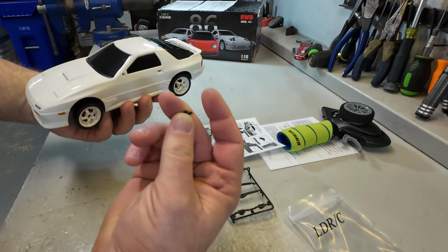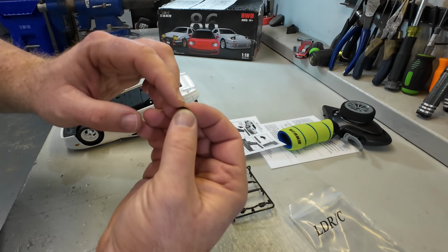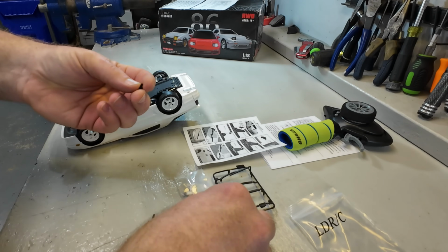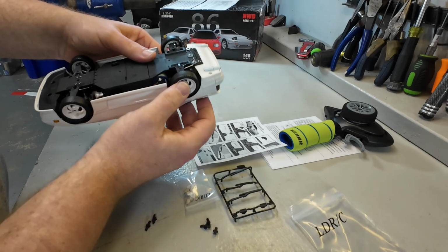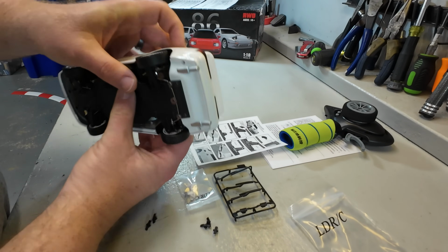We're going to put all of these additional parts now on the car. When you look at these little parts that they want us to put on the suspension, some of them have a very small little raised bump on them. Some of them are smooth. It looks like the smooth ones are supposed to go in the rear. It looks like it just comes in and clips in. Yeah, it just clips in like that. And here's what it's doing. It's limiting the total suspension travel.